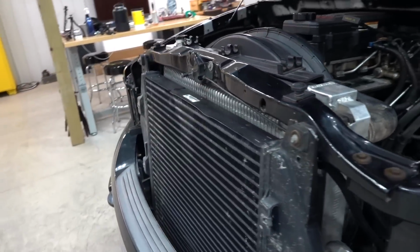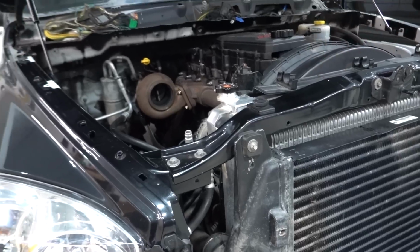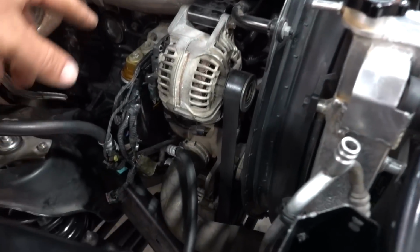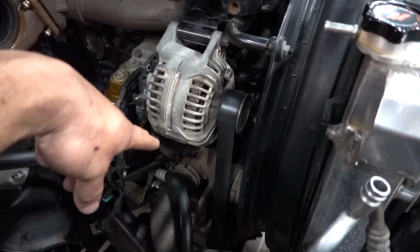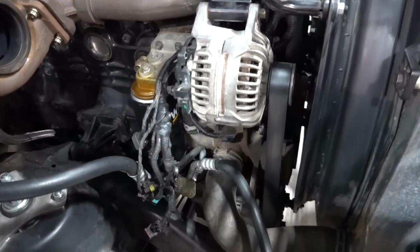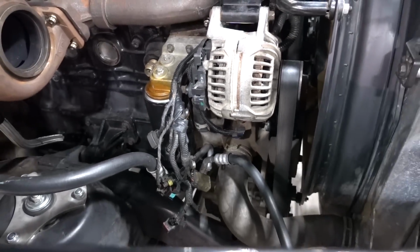And I think what we're going to do is take the old turbo setup off of the 05 and run it on here. Also, on top of that, we are going to change out this lower coolant outlet, because on these 6.7 engines, as you can see down in here, that little 90 metal piece off the back there is kind of press fit into that piece.